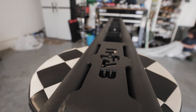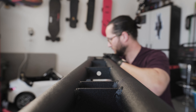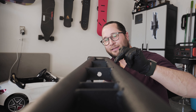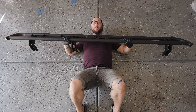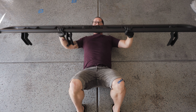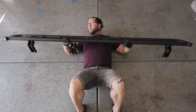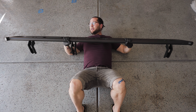It actually looks really nice — almost don't want to scrape it up, but it's going to happen. These rock sliders are constructed using a 0.112-inch wall and a one and three-quarter inch tubular steel, treated on the inside and outside. That means these are really hardcore rock sliders and they'll handle whatever you throw at them. Each rail weighs 33.1 pounds, so that's 66.2 pounds of additional weight you'll be adding to your truck — but it's worth it, gains bro.